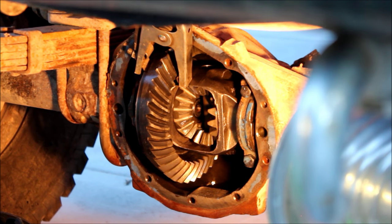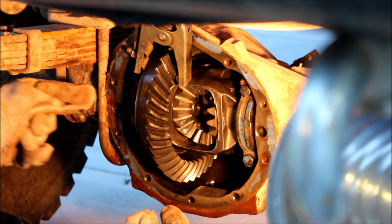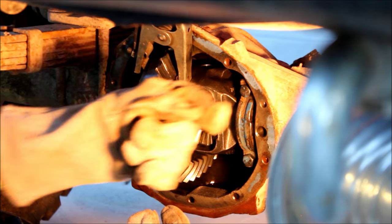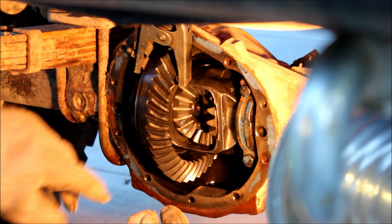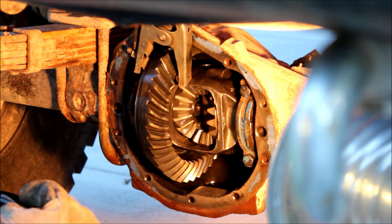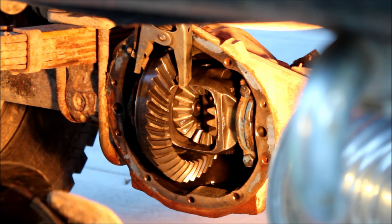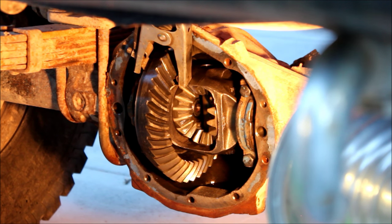So tell me again why you're grounding on the ring gear. Because you don't want it to be on the outside of the bearing — as the electrical current passes through while you're welding, it'll burn up your bearings or put little black marks on them. I don't care to fix it more than I have to. You don't want to have to replace your seals and your bearings.